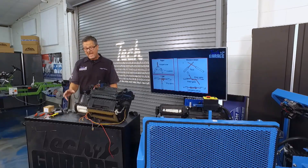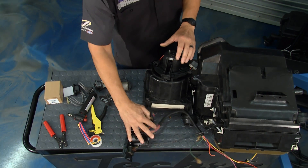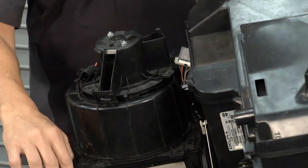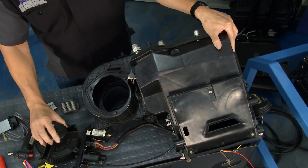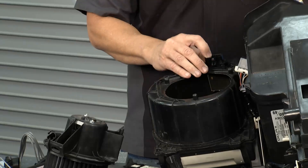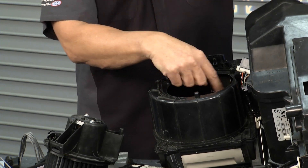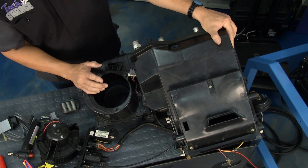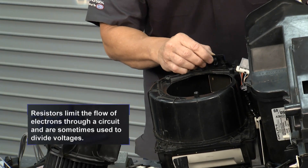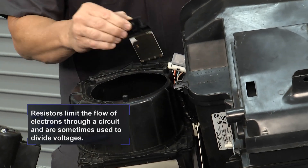So what was Dave looking at? We've got the board right here, and this is the blower motor. What's happening is the blower motor is actually blowing air over the resistor to keep it cool, even with the big amp draw — because it is a resistor. Here's where Dave's resistor was; remember this is upside down since he was laying up under the dash. He was under there with two bolts — here's his connector — he unbolted it, took it out, and just replaced it.